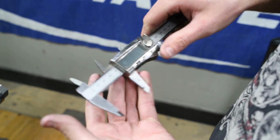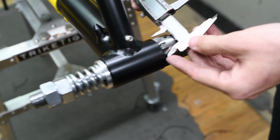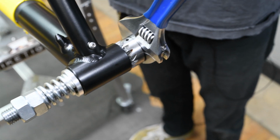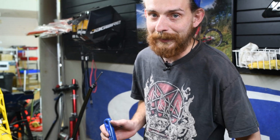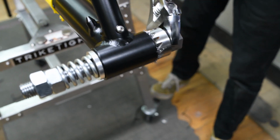Okay. Now, the spec that you want it to be is going to be about 41mm. So just chamfer it and then periodically check. You'll want to take the tool out, put this up. I'll demonstrate here shortly. But chamfering, it's pretty self-explanatory. Just spin it until you hit the 41mm. Also, locking the wheels on your stand, probably a good idea.